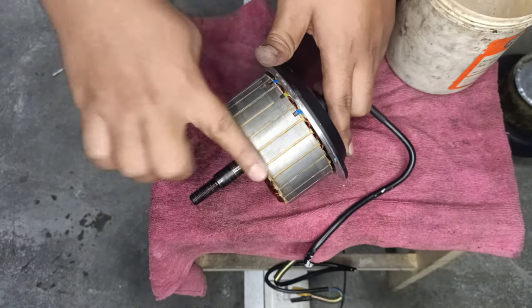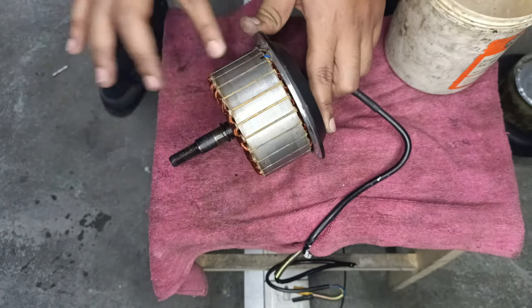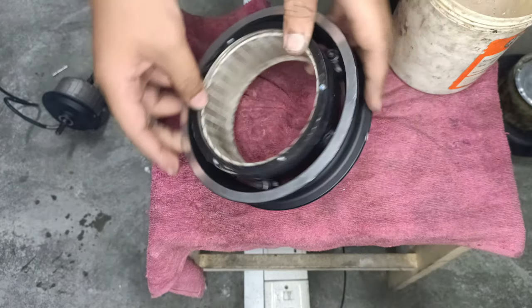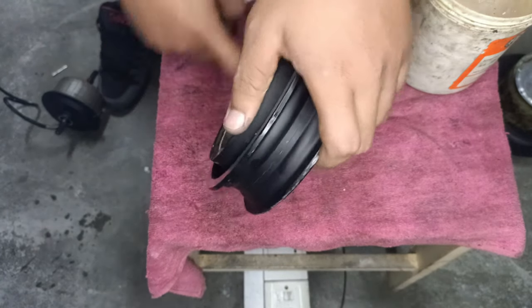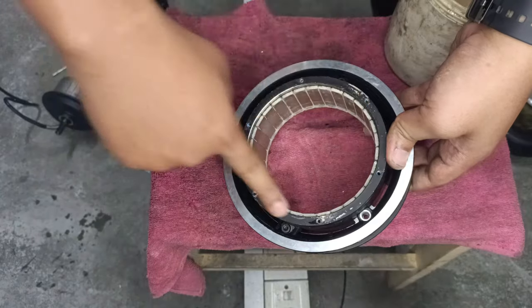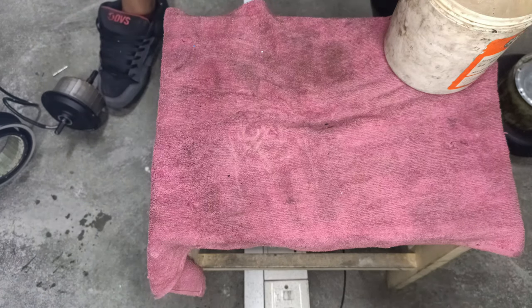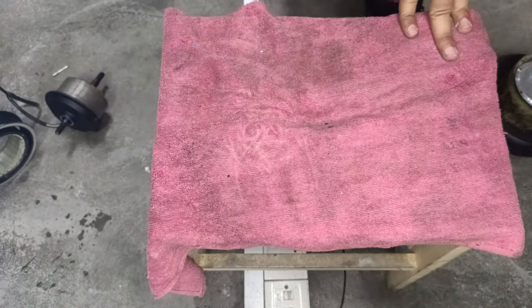Okay, as such, apply generously but lightly, a very thin layer. Alright, one round. Likewise on this, same thing, light grease. All the way around it, the circumference of it, through the 30 poles of magnets that you see here. And then we'll be covering back the motor, and we'll show you a different kind of substance to put to seal it up.